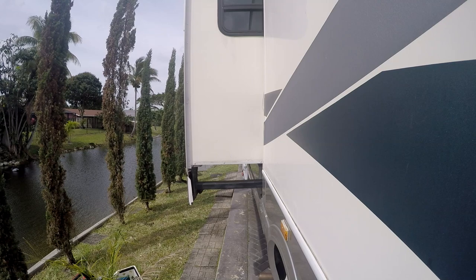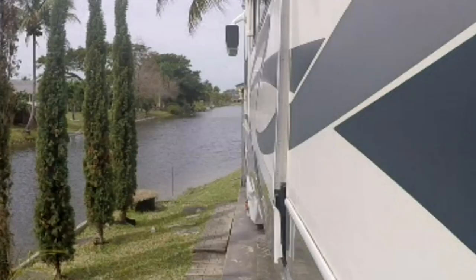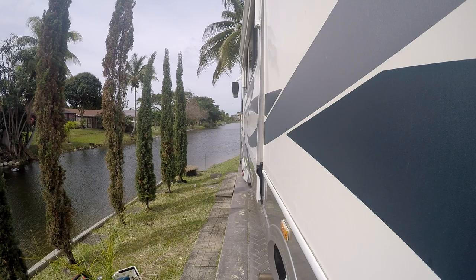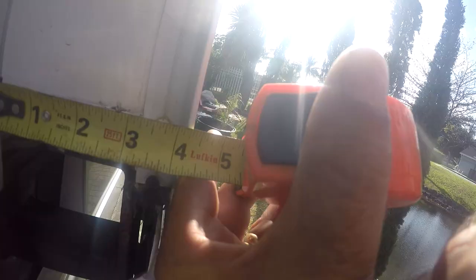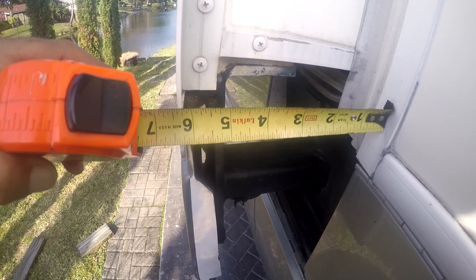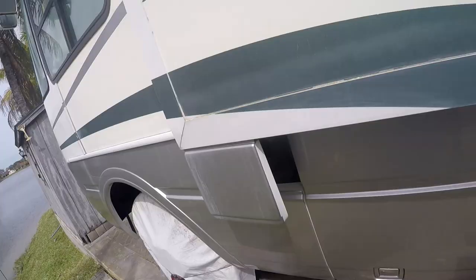While retracting my two-rail slide-out room today, I noticed a slight gap on the rear bottom side of my slide — looked like it was about two inches off, but the front was aligned perfectly. I looked it up in the manual and noticed that the alignment is adjustable. To adjust it, start by sliding out the slide about a foot and measure each side from the motorhome wall to the outer slide-out wall. It's four and a quarter inches on the front, and after measuring the back I come up with six and a quarter inches — so I'm off two inches.